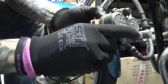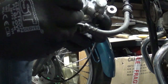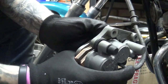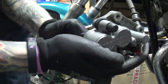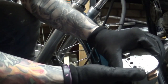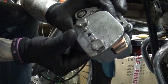First brake pad, and then the second sliding pin pushing the brake pad down, finding that slot in there, and drop the other brake pad in, push it down on the locking tab and push the sliding pin all the way through until they find a way out on the other side of our caliper, just like that.